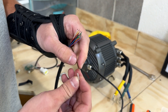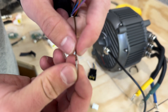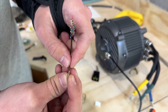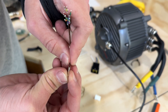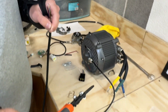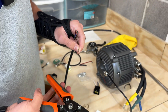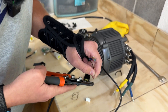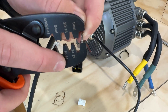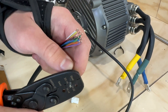Get your new connector and put your wire on there so that the bare wire is inside the flat part and your insulation is sitting on the outer part — you can see that. Then get your crimpers — we got these on Amazon, link in the description. You don't technically need these, you can use pliers, but these work really well. This is going to be the 22 to 24 gauge setting. Line it up and crimp it.